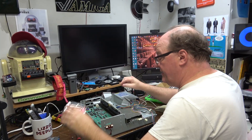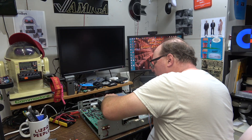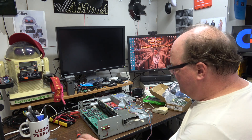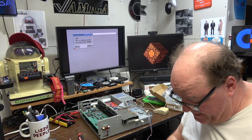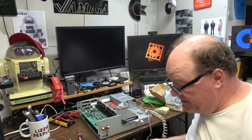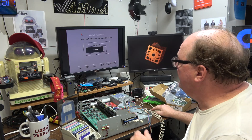I've got the cable plugged back in. I'm simply going to plug this in, and this will bring back native hard drive activity. We'll put this card in here. If this works, we should have his Amiga on the Zulu. Remember to turn your init switch off — init off. Now we should be back to normal, just termination on. Hard drive has a checksum error — if it copies bad blocks, it's going to copy bad blocks. We're going to boot Workbench 3.0. I need to boot off DF0 using the double mouse button. Boot options, DF0.